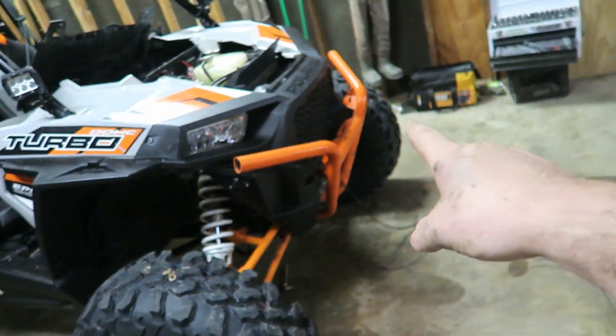Unfortunately it's really buried up in there. I wish I had a high lifter bumper sitting on the front, but the bolts that hold that bumper on are ridiculous. I've ripped that bumper off before — the way they mount will rip out of the frame. You almost have to change them to different bolts. I'm just not really impressed with the quality, so I'm going to stick with what I got — it's a frame mount from Super ATV, I'll link it below.